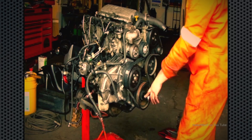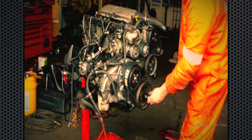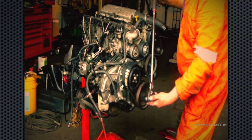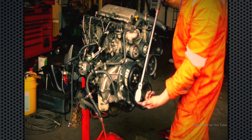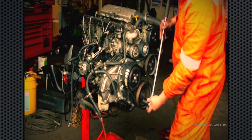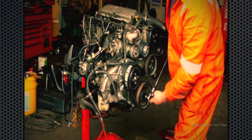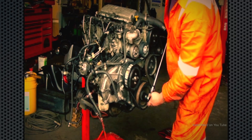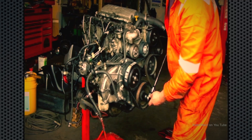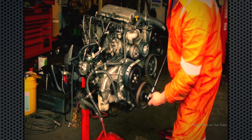What you're going to need to do is wind the crank around — a 27mm socket and a fairly decent breaker bar, this one has actually got a ratchet on the end which helps out. What you find is you have to fight against the compression, so if you're doing it slowly the compression will ease past the piston rings and you can push the pistons up.